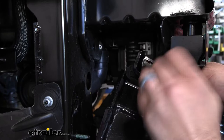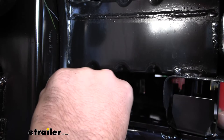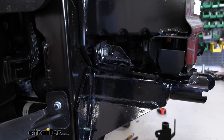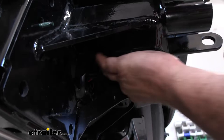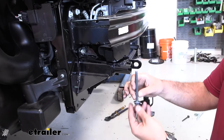Feed the bolt through the base plate, put the pipe spacer on, align it up, and get it started by hand. There's plenty of other hardware to hold everything in place, so just get it hand tight for now — the Loctite will start to dry so work at a reasonable pace. Make sure to use the pipe spacer on the other side as well. The factory tow hook bolts also align with holes in the base plate — you'll only be using one of the two bolts per side, so you'll be left with two extra bolts at the end of the install.